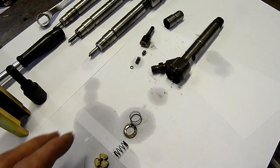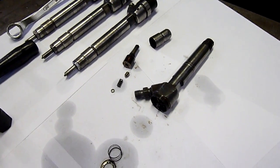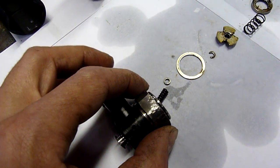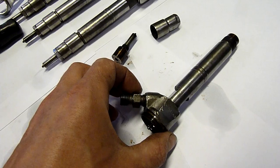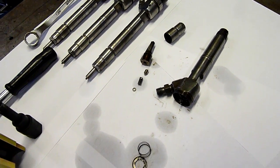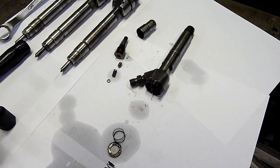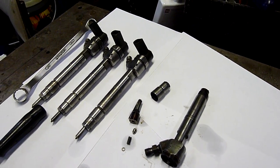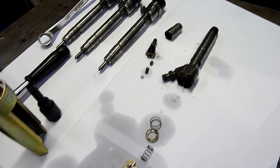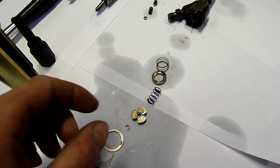One of them seems to be a bit iffy; the other ones look really clean and serviceable. I'm going to send them off and get them tested. This one here has probably had its day. The tip-off was not only the fact that it was so well stuck that they've used mole grips or vice grips to try and extract it from the head, but the golden brown color of the spill return line and even the fuel input line was a bit rusty looking. I wonder if it's even off a different engine — probably another scrap engine sitting out in the yard. I'd say they've just yanked it out of a dead cylinder head and thrown it in with the lot, but I'm not too fussed about that for what I paid.